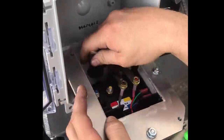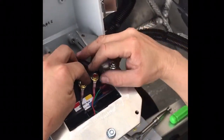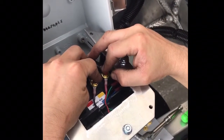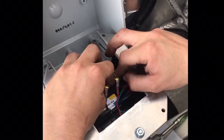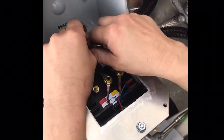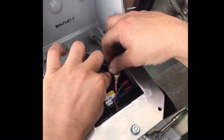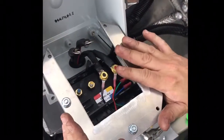Basically all I'm going to do is pull these two wires off and touch them over here. Now I have to listen to the motor and see which way it's going, to decide if I have to swap it around or not. So I'm going to try it now. That opened the system — I'm going to swap the two wires around and that closes the system. And that is what you do to bypass this box.